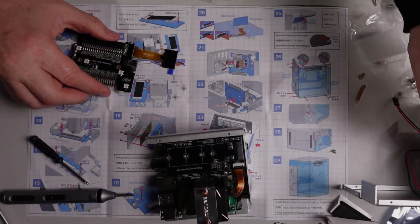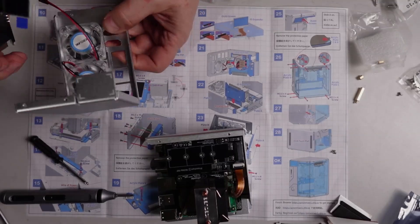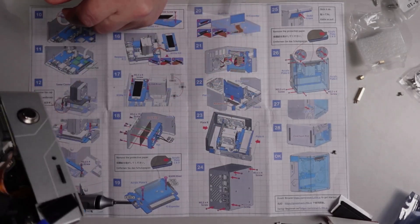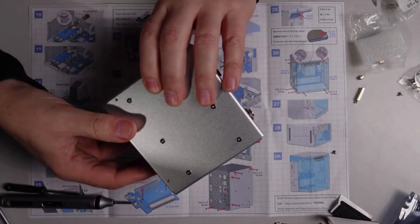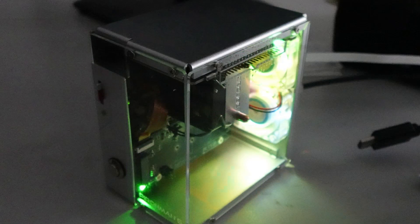I'm really impressed with the cooling of this device — the Pi 5 seems to have real control over the fan with different levels as per the heat. Next we install the NVMe slot, installed with a ribbon cable — make sure not to damage the cable. There's also a ribbon cable used to install the little screen, which is connected to the same point. Screw the two fans to the back of the other component, then put the two components together. To finish it off, take your two perspex covers, screw them on carefully — don't over-tighten as that may crack the perspex.